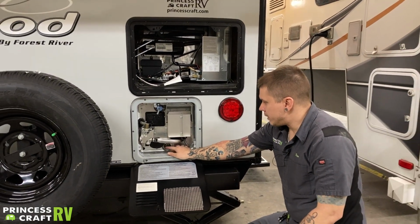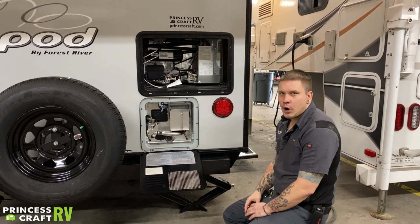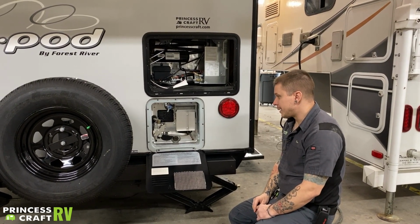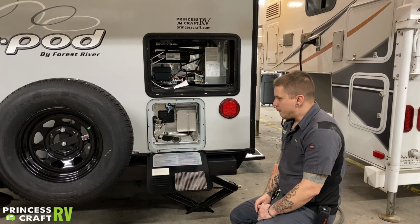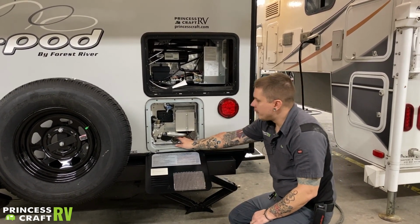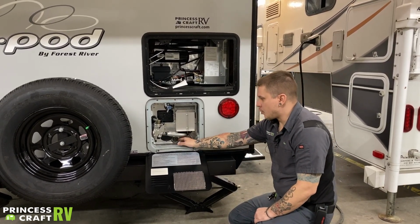What an anode rod does is it's a magnesium rod, acts like a magnet for hard water deposits, calcification, things like that. It is a consumable part. Expect to get a year or two in between changing anode rods. Again, you should be well aware of the condition of it, because you're going to be staring it in the face every time you drain the water heater.